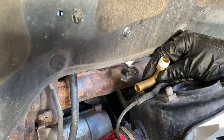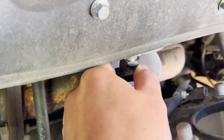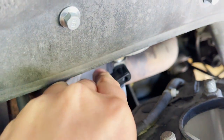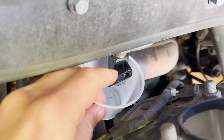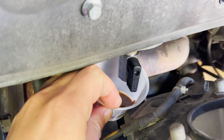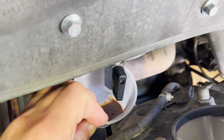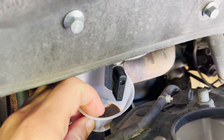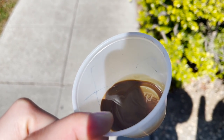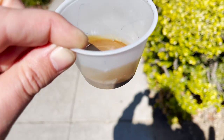It's been a little under 5,000 miles and we're ready for an oil change. We're going to drain this and see how much oil we caught in the catch can. And as you can see, it's a fairly significant amount which would have ended up being pushed back into the system and burned up, making things dirty. So this is definitely something worth adding to a supercharged 4Runner to keep things a little bit cleaner in there.